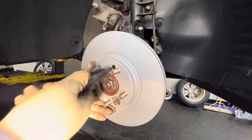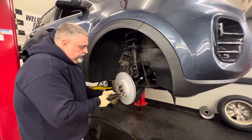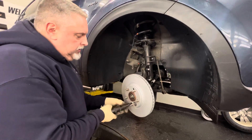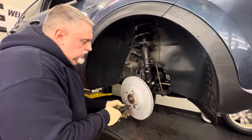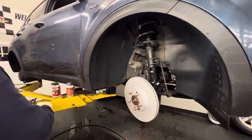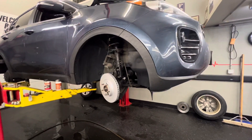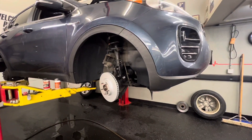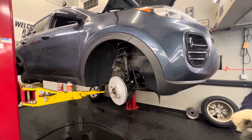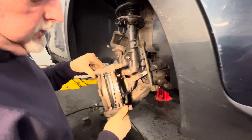We left a good distance on the brake pads because we want to slide these on without hitting the rotor. Now I'm going to squish them together and put the clips in right now — actually we're going to put the bolts on first. Catch the bolts in the back. Tony wire-wheeled them all and put never-seize on them. Bolt these down first — these are 17 millimeters.